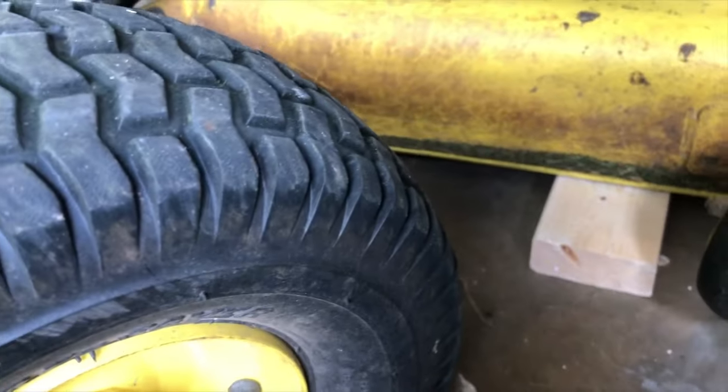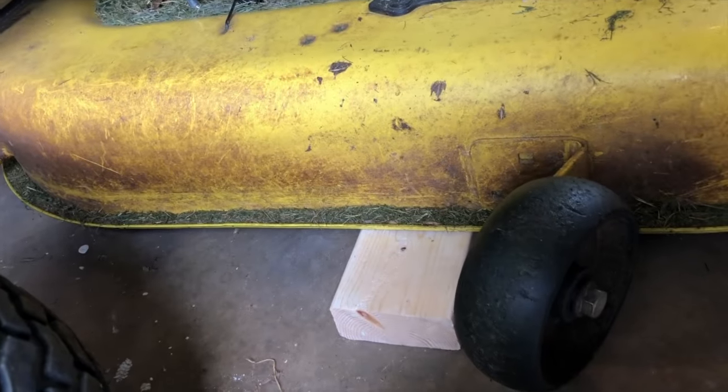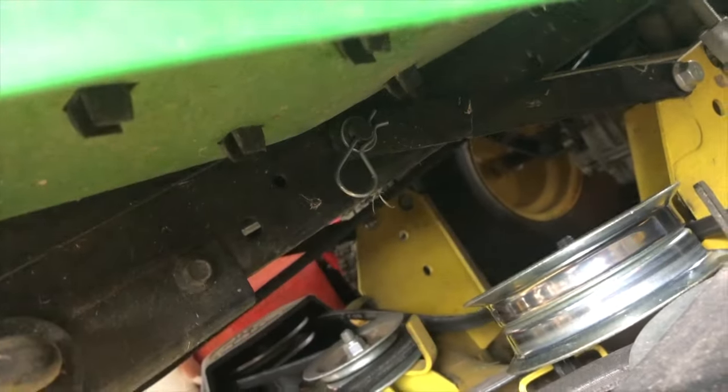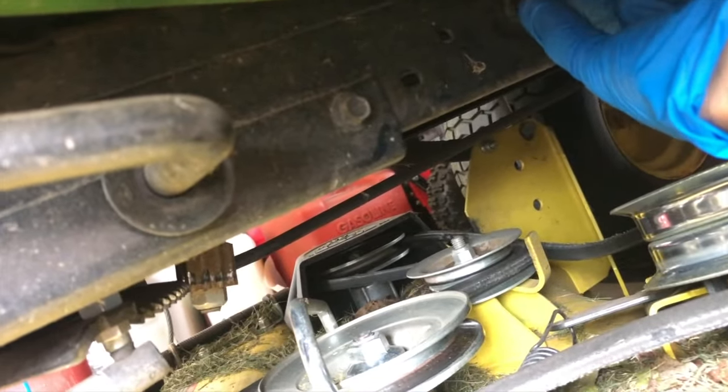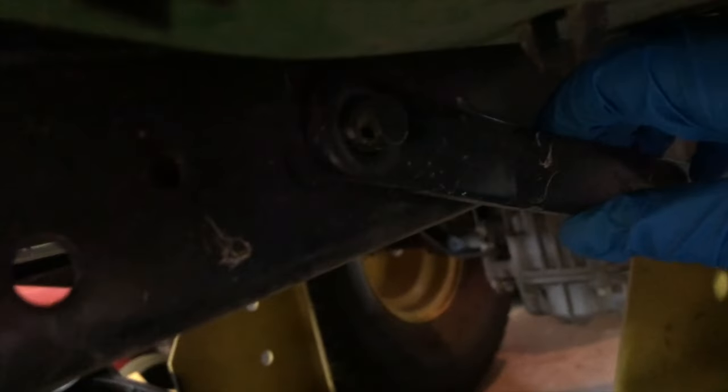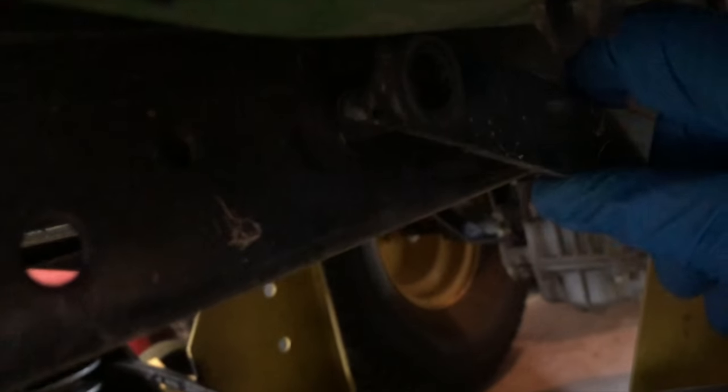Your manual walks you through these steps pretty well. First, we're gonna start grabbing the spring locking pins and washers on the draft arms underneath. On both sides of the deck we've got to take those out — pull the pin, grab the washer, then pop the arm off.